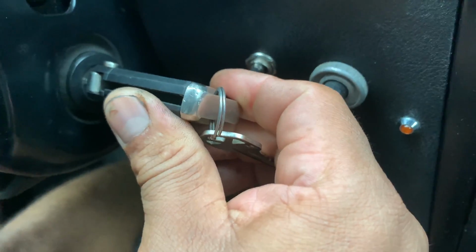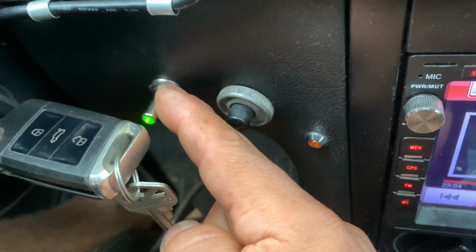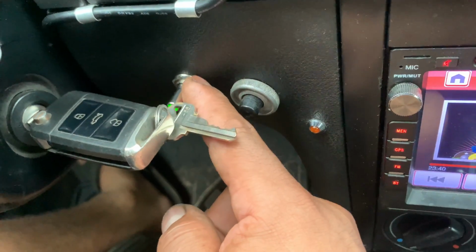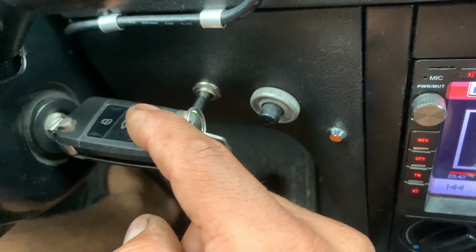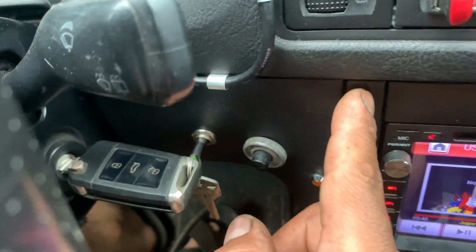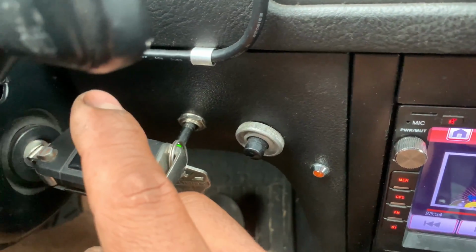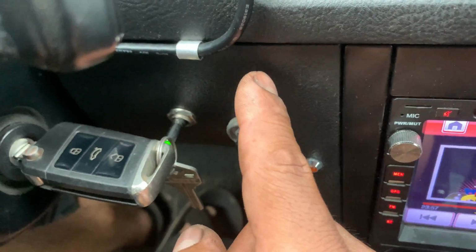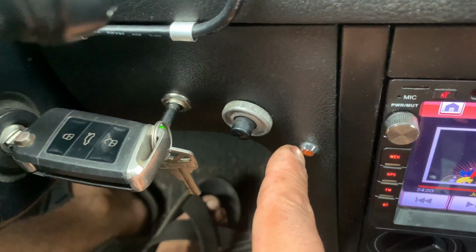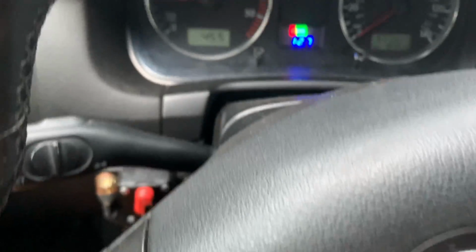Remember, that's the on button. So basically, this is power from the fuse box. So fuse box to here, the one with the key, the key power to here, from here to the boost switch, from the boost switch to the solenoid, ground the solenoid, and put an extra wire so that when the switch is seeing power on the other side, this light will come on like this. See, it's on, and that's it. Nothing else, no trick or anything.